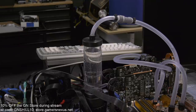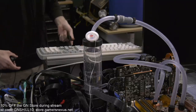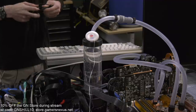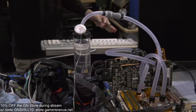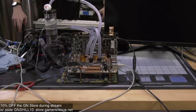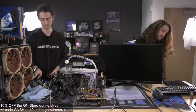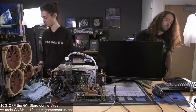All right, I think we're caught up on Super Chats for the most part. Adam Stafford, $199. Will my 750 watt power supply be okay for 3950X, RTX 2070? Probably. I don't have a 3950X. Well, you already have the power supply, right? I mean, RTX 2070 doesn't draw that much power. 3950X, if it's anything like the 3900X, should not draw an insane amount of power. You'll be fine.